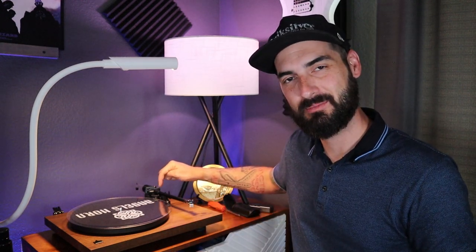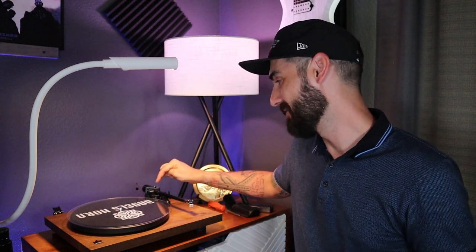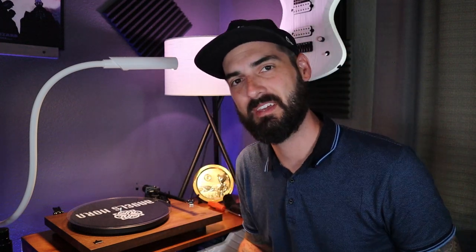There's a little bit of flutter on there, but that's totally fine. For an entry-level turntable, this is acceptable. So now that I've done all of that, the turntable is in working order. Remember: loosen the screws if you have one that's very sticky or not balancing correctly. Don't take the dial and weight at face value — it's not correct. Check it with a scale. These things are cheap — I think this cost me about $6.99 on Amazon. Once you have all that done and everything's balanced, check your calibration. It's working. I'll give this a thumbs up to use.